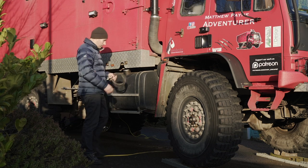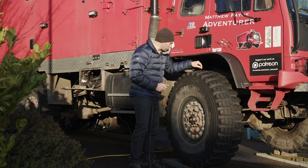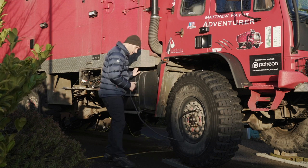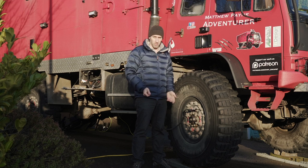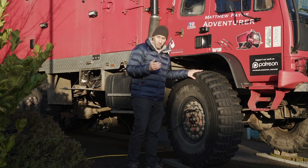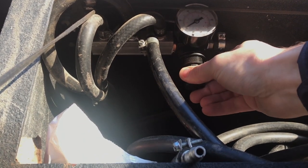I've devised my own system — there are many ways of doing this. I have a central tire inflation system on my truck. On each corner I have installed a PCL quick connect, and this one is under here. This has a quick connect so I can inflate all four tires simultaneously. The benefit is you can leave the danger area, have a cup of tea while the truck's compressor does all the work. You don't want to over-pressure your tires, so I have a pressure valve which I can set — I have this valve here where I can set the target pressure.